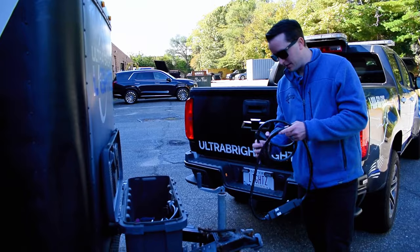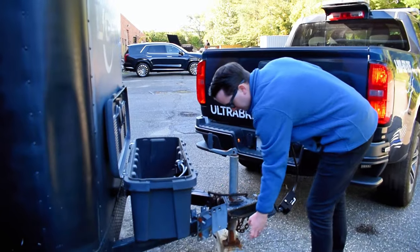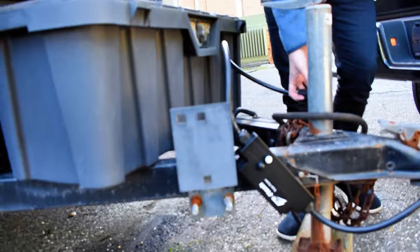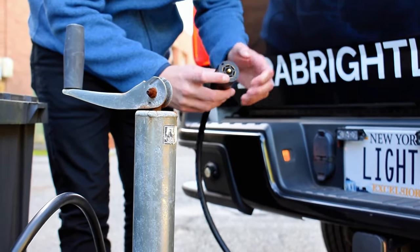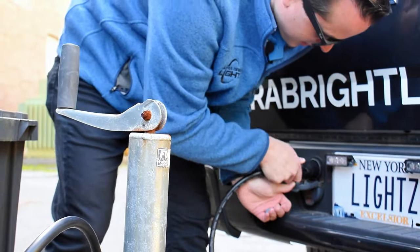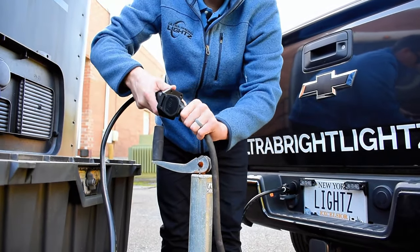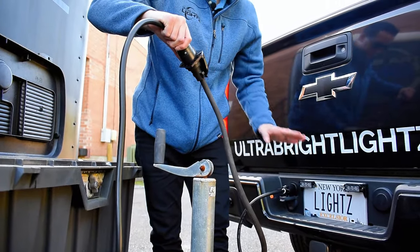On one end is a male and the other end is a female. There is that magnet, so in my case because I'm just doing this temporarily I can just go ahead and magnet it right to the tongue. I wouldn't leave it like that if I was going to move this trailer, but just for the simplicity of the video I'll leave it there. On our Colorado we have both a 7-pin and a 4-pin. If you have only a 4-pin, you can purchase an adapter available on our website that will turn a 7-pin into a 4-pin and it'll work just the same. I'm going to plug it in right here and then take the other end of the trailer flasher and plug it into the trailer. This goes right in between the vehicle and the trailer — there's no splitter or anything like that, it's just sitting right in between the vehicle and the trailer.